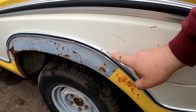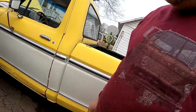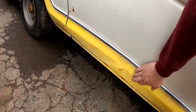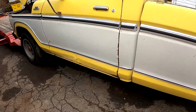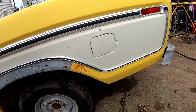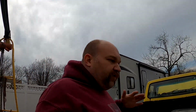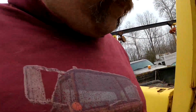But the bad part is almost every single piece has pinches, dents, waviness. Now, some of these real moderate ones, like if you were able to clean this door up, pop that dent out, you could probably bring the trim out. With this aluminum trim, these sharp dents, especially where it's buckled, you're never going to get that out. I can't remember off the top of my head of all the trims that Ford has reproduced, if this one is currently reproduced. Either way, the trim's getting expensive when it's in good shape, whether it's factory or reproduction. So anyway,